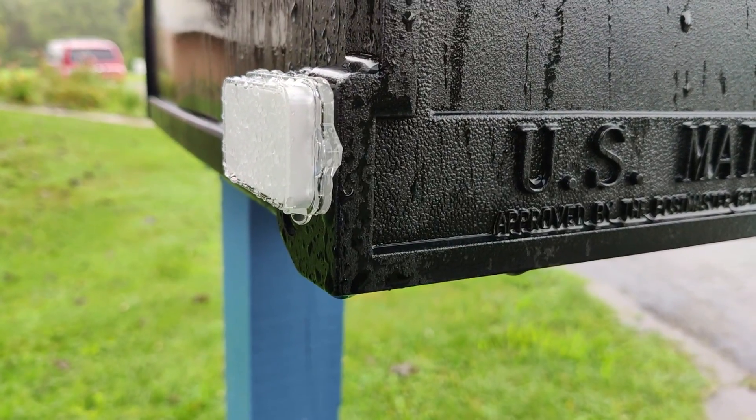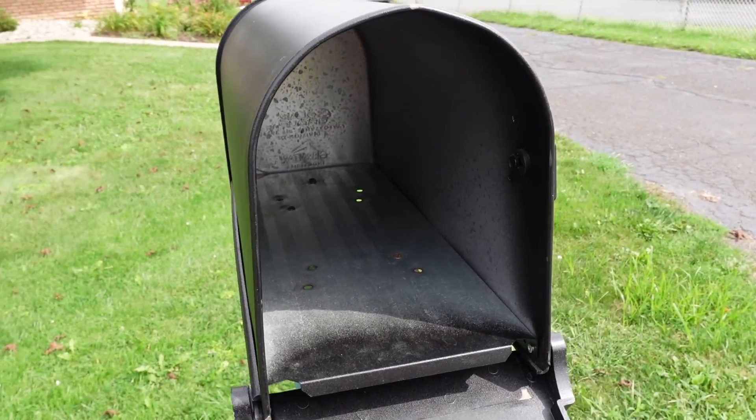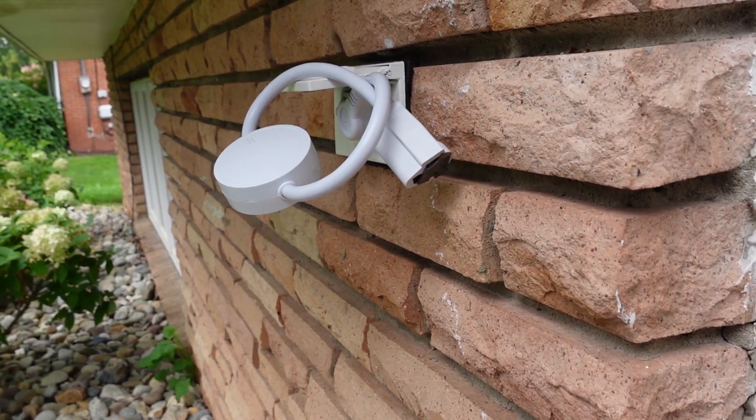Once I got this sensor in range of my Home Assistant Z-Wave network it was extremely reliable and I would highly recommend it. I haven't had it long enough to fully test battery life, but so far it's been good and the waterproof case held up great in wind and rain. The biggest lesson from this project is how much metal can attenuate Z-Wave signal — a metal mailbox or a metal door can inhibit the signal far more than I expected. Not only that, but brick also matters; even though Z-Wave is supposed to have a much longer range than Zigbee, the construction materials of your house are important to keep in mind when placing a sensor far from your hub.